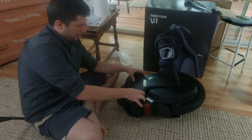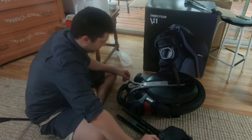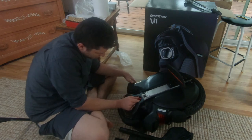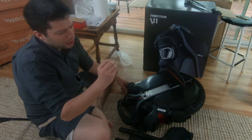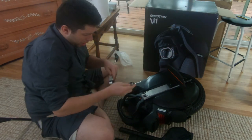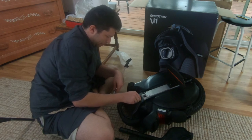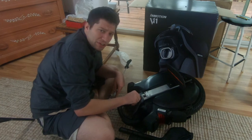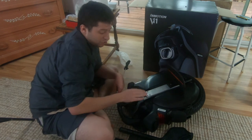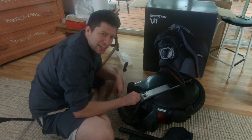The saddle panel should slide right off — easy peasy. And here is your top valve, which has really nice little metal caps. How come we don't get nice metal caps for the bottom one? The top valve I'd like to fill to 50 pounds. People are suggesting half of the bottom valve pressure in the top, so since I put 150 that would suggest 75 up here, but InMotion suggests 50, so I'm just going to start at 50 and do tests on that later.